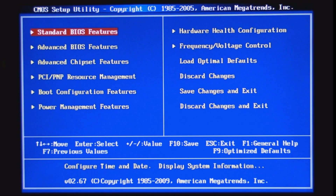For i7 overclocking, I suggest you get memory which is 1600 MHz DDR3. Good brands are OCZ, Corsair, and G.Skill — stick with those. 1600 MHz is nice; if you can get higher than 1600 it's a plus. 1333 MHz memory is not very good for overclocking.